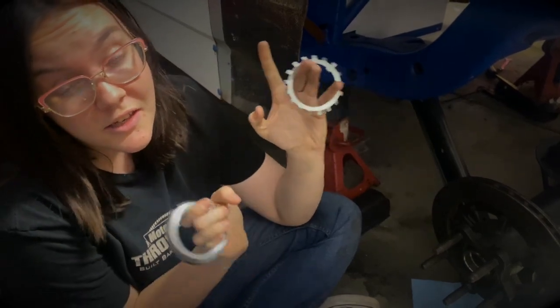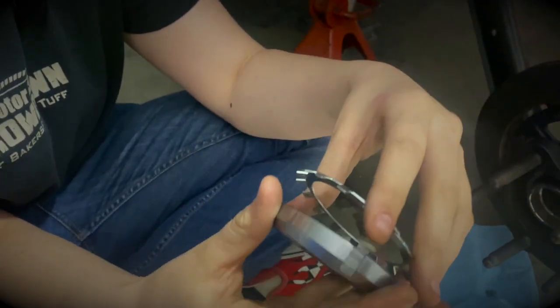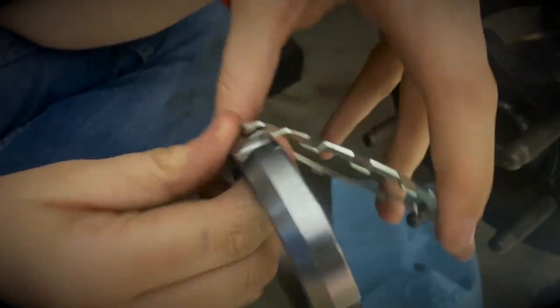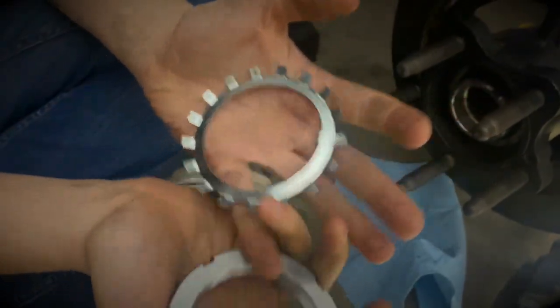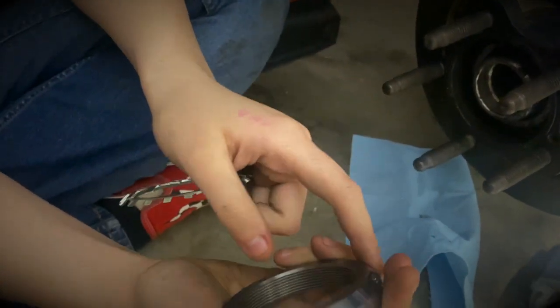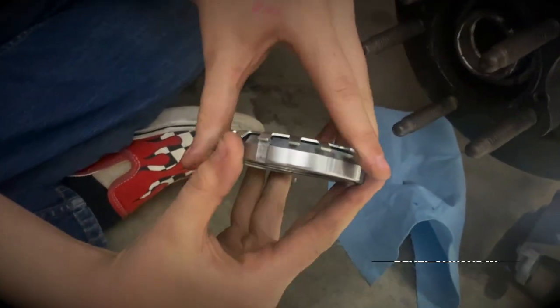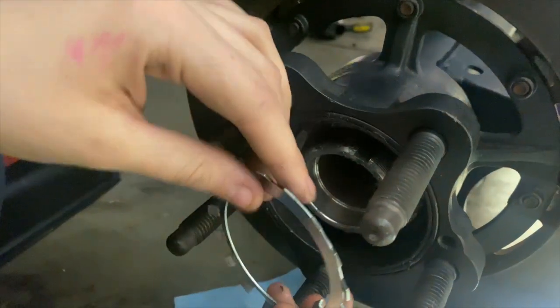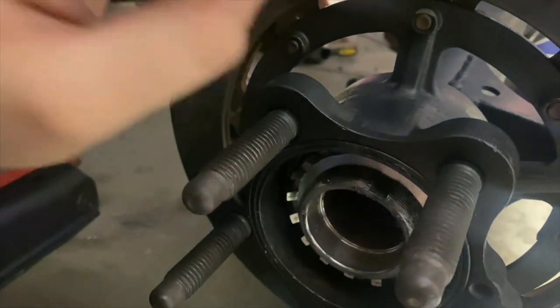For the lock and the nut, there is a right way to do this and a wrong way. The wrong way is the way we actually got it. If you put the lock and the flat side together, you'll see there is a little bit of space in between - it will never be able to tighten because the keys will catch and it'll just never be right. That leaves room for imperfections and bad things to happen. The right way is for the curved beveled side and the lock - you'll feel it, it feels natural, just put that in there. There's a little slot here, just going to make sure it's in right. Slide it in - that's done.